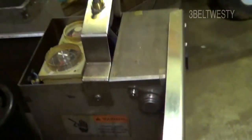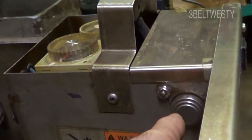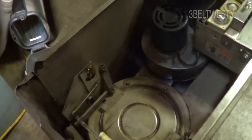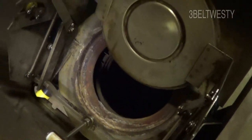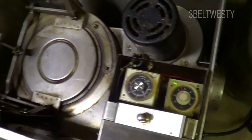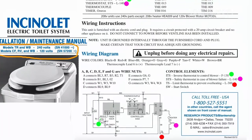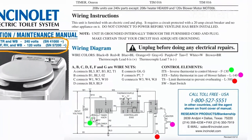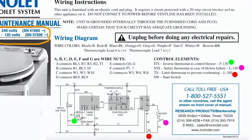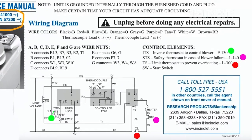There are three thermostats on here. This is a safety thermostat in case the case gets too hot. The whole cycle took about an hour and 15 minutes. This is the Incinolet schematic I got off a manual — it's online. The serial number shown is 53,000 for a 120-volt model. Mine has the green cycling thermostat for the blower, and also the red and violet thermostats, which are safety thermostats for UL.